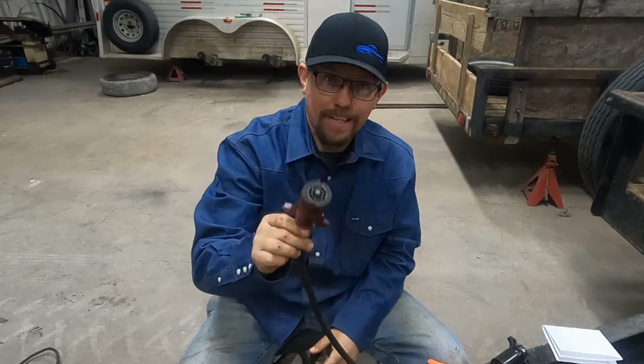So let's get started. All right, the first thing we're going to do is remove our cover. So we're going to take off the cable clamp, and normally there's a set screw right here, but this one's broke out, so we'll have to do that. Let's take the set screw off. Push your cable out. And like I said earlier, if you're just needing to put a new plug on it, you can note where the wires go, their position on your piece of paper, and then you can just put the plug back on it. The scenario we're gonna use today is as if maybe the plug were cut off or ripped off and we don't know which wire goes to what, so we're gonna cover that. So let's take all of our wires loose.